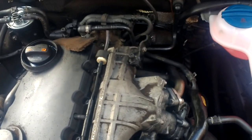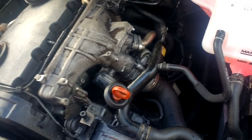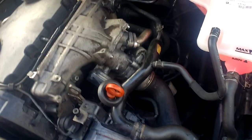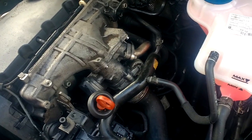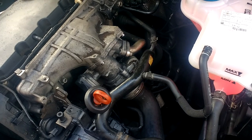So what I'm going to do is take this car into the countryside and carry out this treatment, because one of my subscribers said there's some amount of black smoke comes out of it if it does the job. So we'll try that treatment right into the air. And in fact, before I do that, I'll take a reading from my scan tool of what the pressure is in the DPF at 2,500 revs.